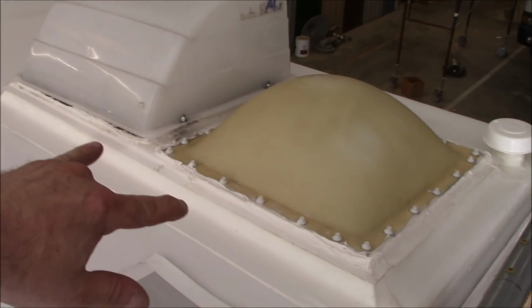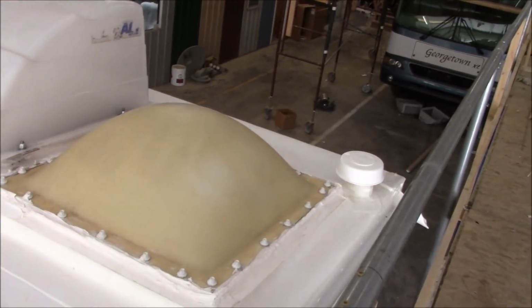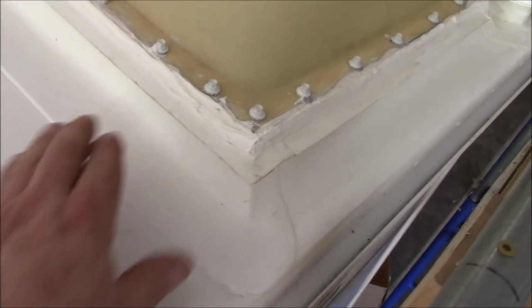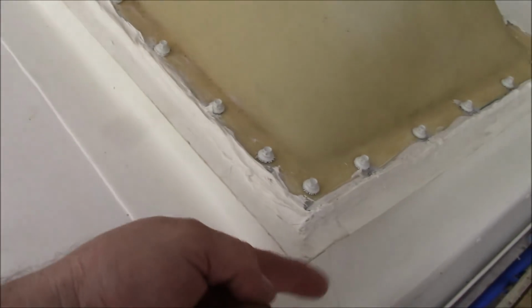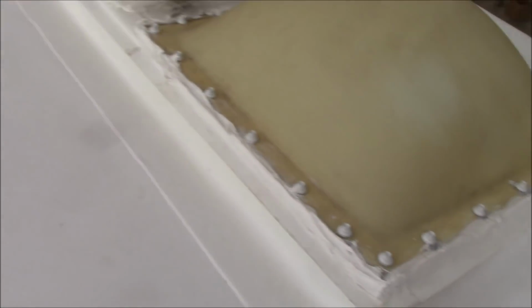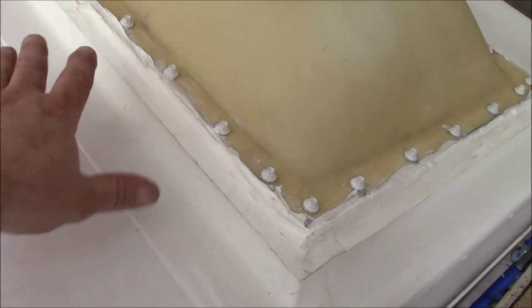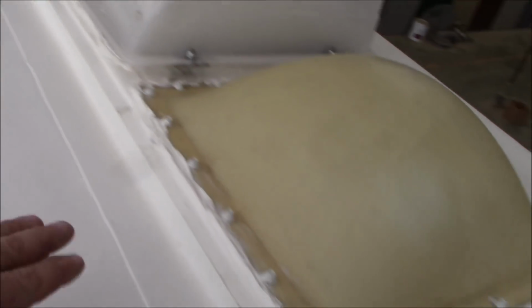This had the double, and then it also had the plumbing. That's all one big curb component. It's all one big piece. And then it also has a counter flash right here. So when water tries to come across the roof, it'll come up here and hit, and it'll get directed around and get off. You know, obviously, you'll have water coming on, but you're trying to keep the main rush of the water off the roof deck, up against any caulkings or anything like that. You don't want that erosion effect to happen. So that's really the purpose for all of this.